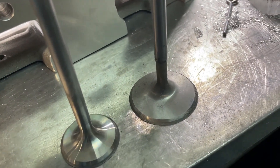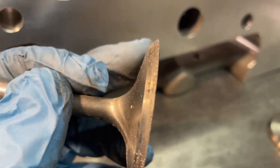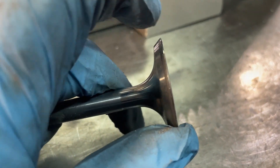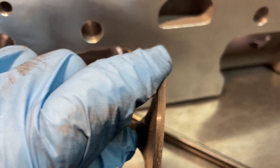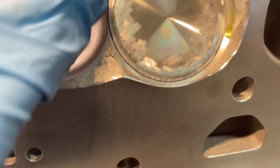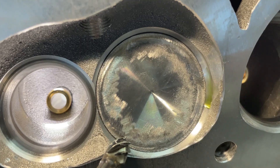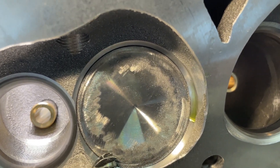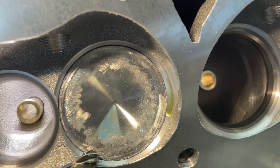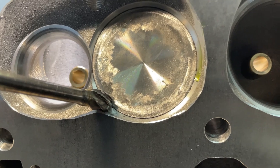So how do you deal with that? What you need to do is find some junk valves and take them to a machine shop and have them grind it down so that there's no margin. The margin is this flat part right here — this is the valve job about where it seats, and this is the margin. You want to grind that margin off. When you put the valve in, it covers up the valve job but allows you to get in here with your burr to grind. If you don't, it'll push your burr too far out and you won't be able to get rid of the lip entirely. So you have to have the margin ground down flat so you can get in there with your burr. Otherwise it raises you up and you can't get down to where you need to be.